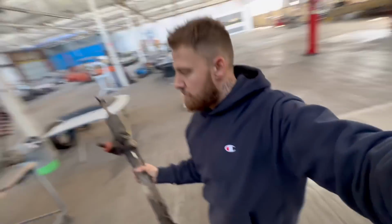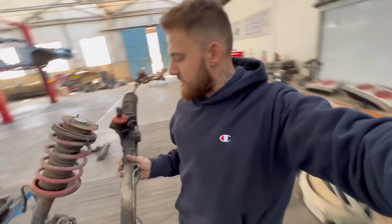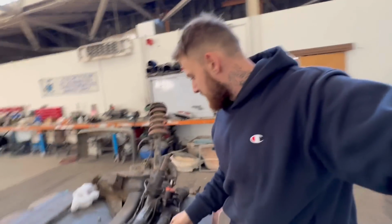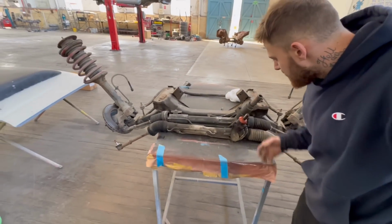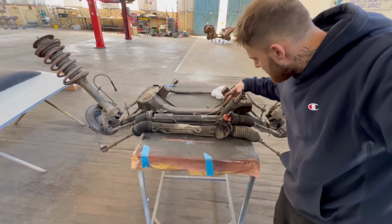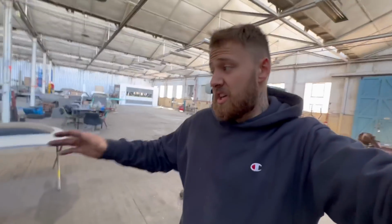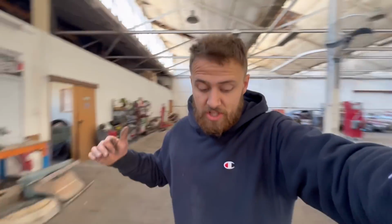Now the difference is, if you have a look here, look at the difference in the power steering head. Now what that's gonna make is, when we go to put the extractors and get the extractors made, that's gonna give us 10 times more clearance, because some of you would have already known that getting extractors in and out of these early Commodores is next to impossible. So we're gonna try and make that as easy as we can.